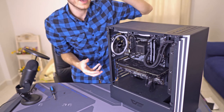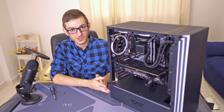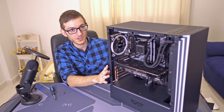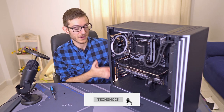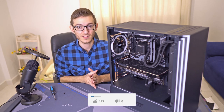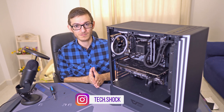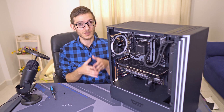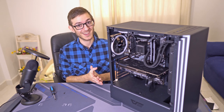So yeah, that's how you install a video card. After this, you boot up your PC. Everything's hooked up right, your PC boots into Windows. You'll need to download the latest NVIDIA drivers for your specific card, because if your video card came with a CD with the drivers, it's outdated and it's useless shipping weight. So just go on there, download the drivers from NVIDIA's website, restart your system and you should be good to go. Thank you for watching and subscribe if you like.